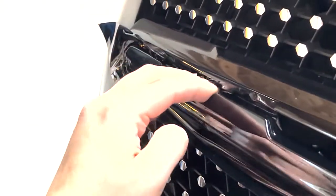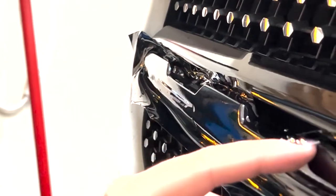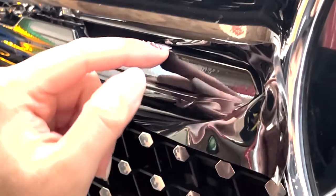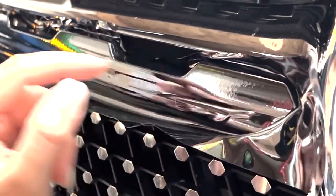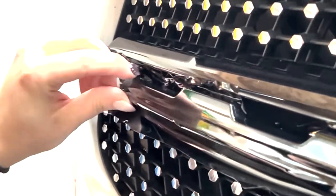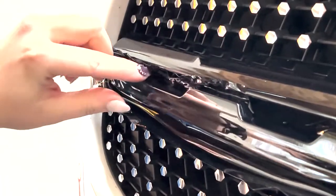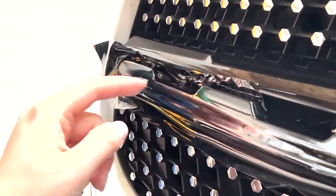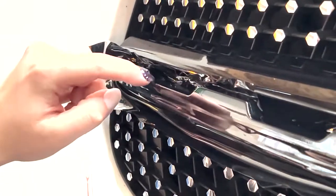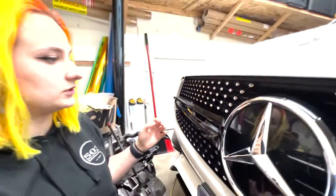Also, the way that I move the material has kind of a system to it, essentially. So with every peak, every corner, like I was saying, do your corners first. I will also push out the material from the corners into your recessed areas. So same thing here. What I did is I pushed this out and then pushed this corner in, because you want to feed the material essentially into this groove. Because if you don't, then obviously it'll pucker up, because the memory will want to come back unless you post heat, obviously.